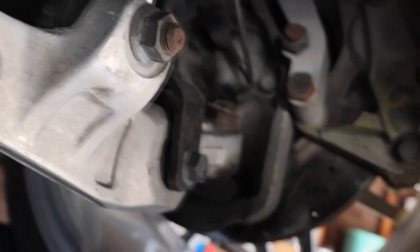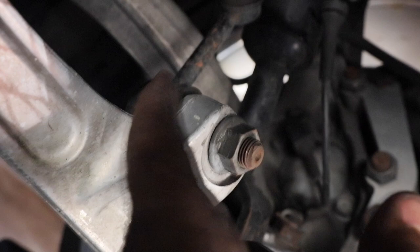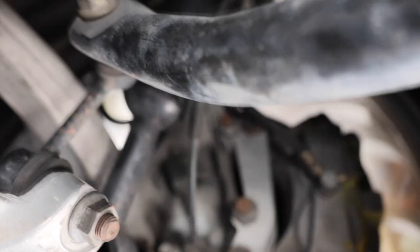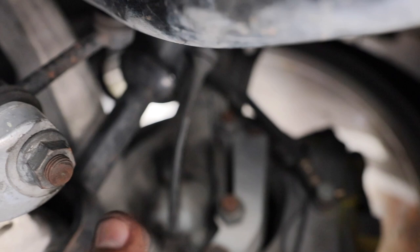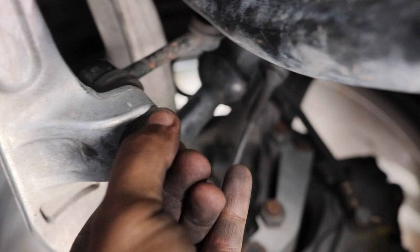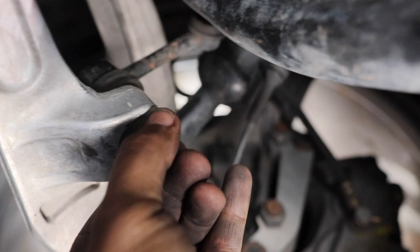I just made the biggest mistake of my life — I'm noticing right now that we're on the stiffest setting when we should be on the loosest. If I didn't record all of this I would have made a lot more mistakes — recording is basically double-checking your work. Now tackling the front sway bars. I've been hearing a squeak from the driver's side front. Here we have the lower control arm and the end link that connects to the sway bar — look how loose it is. I can take off the bolt with my hand. Never in your life should you be able to remove a nut with your bare hand like that.